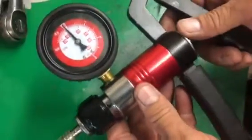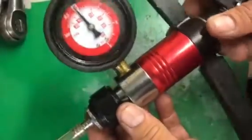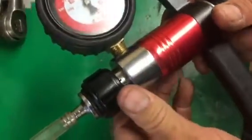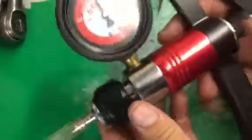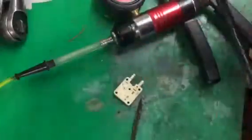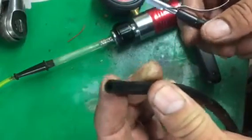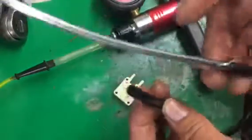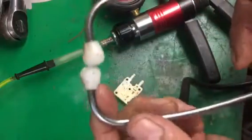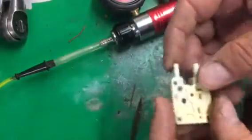One tip: do not get liquid in these. Don't use it for brakes or anything with gas or oil — if you fill it full of any kind of liquid it'll ruin the seals. A lot of people get them to bleed their brakes, get brake fluid in them, and ruin them. You also need a doctor's stethoscope. I use this stethoscope to hear air leaks. Pull the little drum out of the end of the hose and throw it away so you just have a stethoscope with an open end hose. Be careful though — if you get a lot of air pressure in there you're going to blow your eardrums right out of your head, so don't injure yourself.